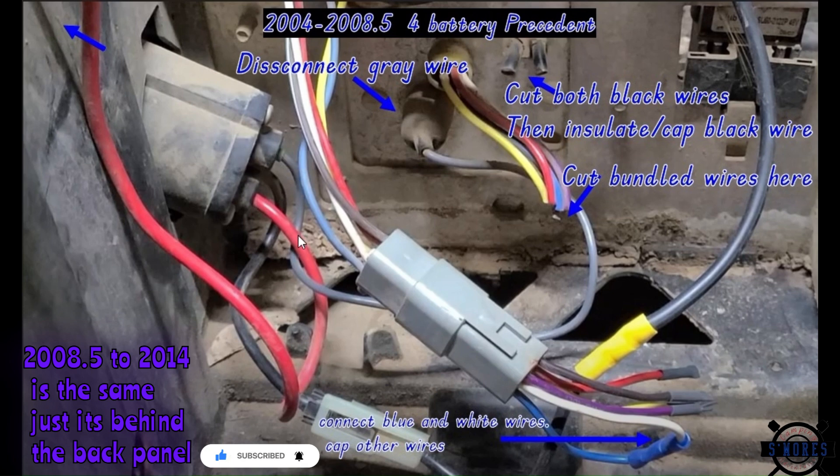If you follow this thin black gray wire, it's going to come here — you want to unplug that, just disconnect that. This red wire is going to go all the way back over to the other side and connect to the top of the solenoid. Use a half-inch socket to pull just this wire off, and then put the nut back on so that all the other wires stay on the solenoid.